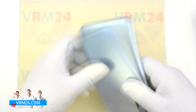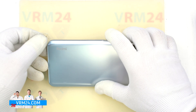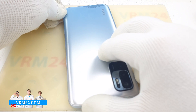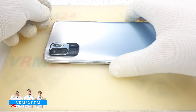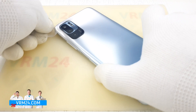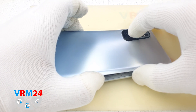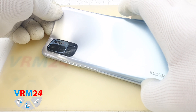After three to five minutes we are ready to go. We take a plastic film or sheet and put it in the gap between the cover and the middle frame. Spray some isopropyl alcohol and slide the opening tool along the edge. Be careful where the cameras are located — there is a hole because the cameras have their own cover, and the opposite cover side is narrow and thin and easy to break. Along the edges around the cameras, the cover is also glued with adhesive. Bend the cover carefully and remove it.